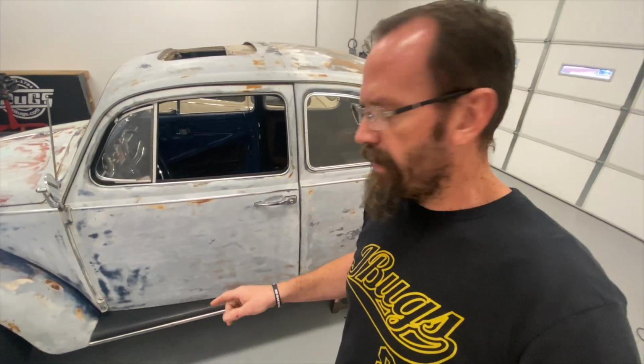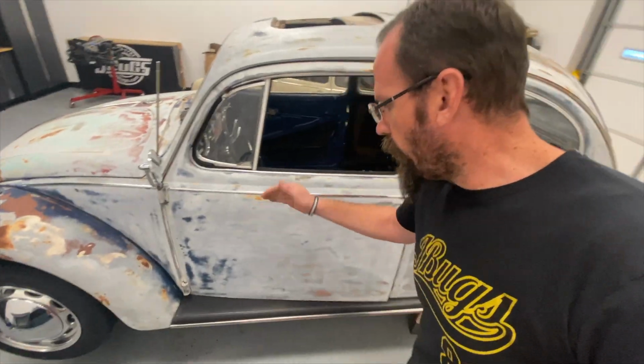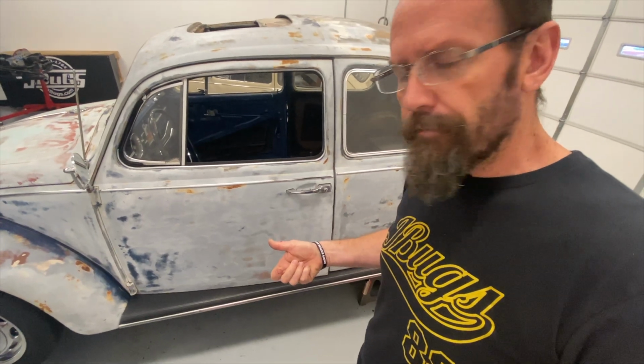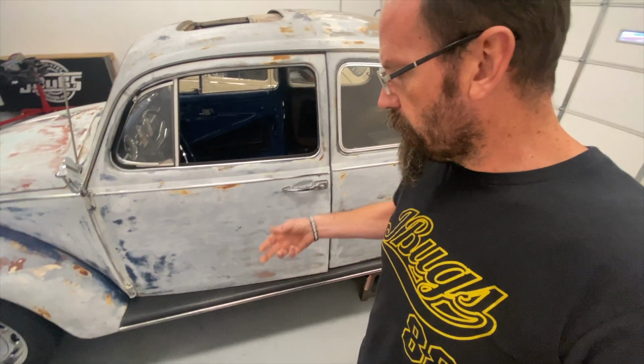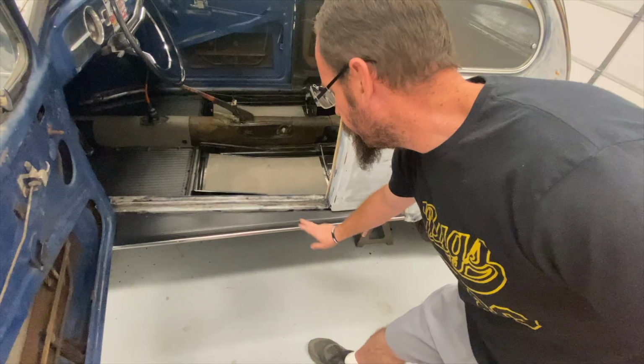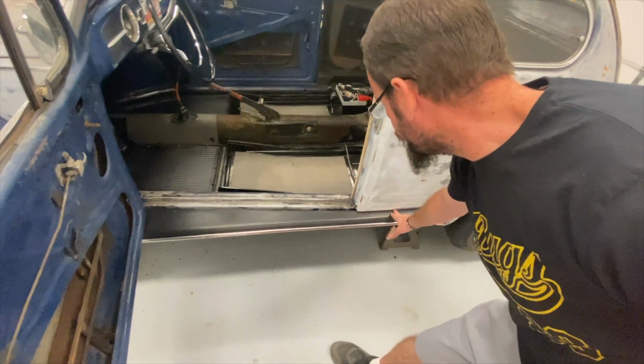The biggest thing I found is trimming back that rubber lip on these rubber mats that rolls over the back edge and is tucked underneath the bottom. With that rubber lip in place, the running board is too tall to sit in the groove underneath the body. So once that mat is trimmed, the running boards sit down just fine.